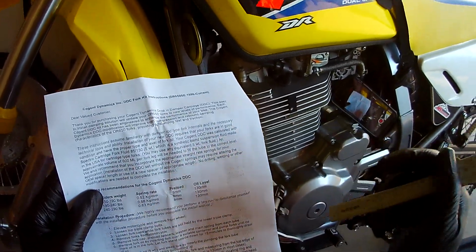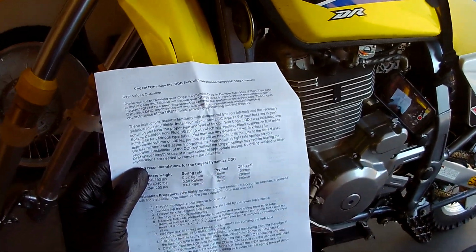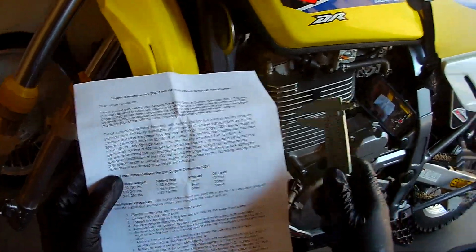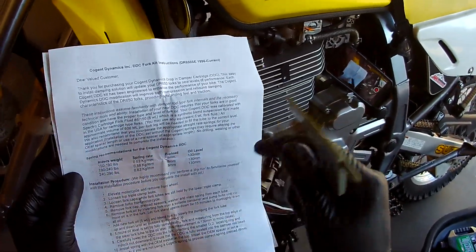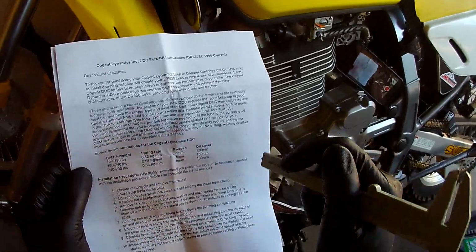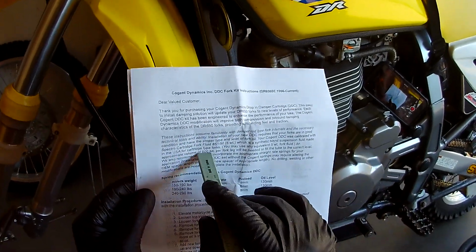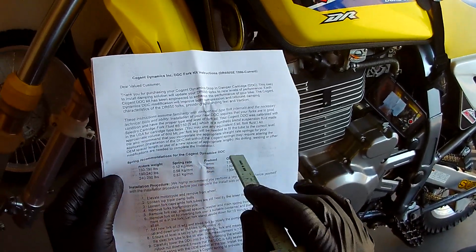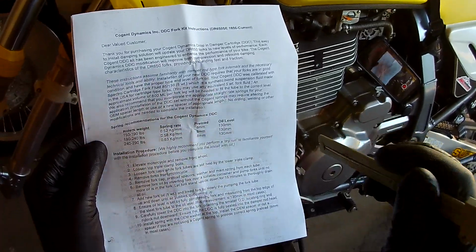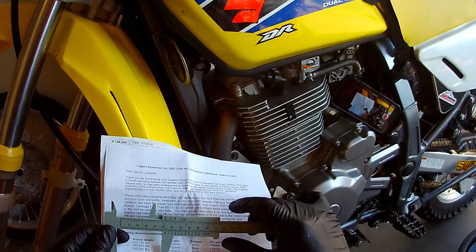130 millimeters of oil is 5 inches and like a 1/16. So I put it to there, and actually I went 5 inches. So that just put me like a 1/16 extra oil, because I kind of messed up on the math at first. I forgot that it was 5 and a 1/16, which would have been right at the 600 cc's per leg. Millimeters, cc's, same. Had I put it at the 600 cc's or milliliters, like I had poured it in, it would have been just right on. But then I bumped it up to 5 inches because I wasn't thinking 5 inches and a 1/16. So, but anyway, I have 5 inches of oil level. So just cut me some slack on that, man. That's all I ask.